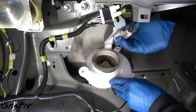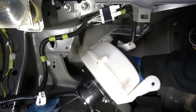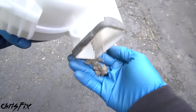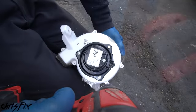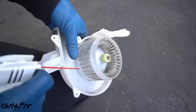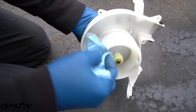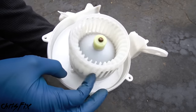With the air duct removed, there's something very important I want to mention: cleaning out this fan. A lot of people skip this step when replacing their hybrid battery, but it's very important for the long life and reliability of the battery that your fan isn't gummed up with dust — it's a common problem on these. Remove this duct to inspect the fan: there are three clips, press the center of each clip in, and this will pull right off. And I'm glad we checked, because look at this — those fan blades are caked up with dust.